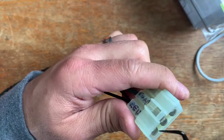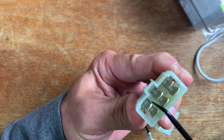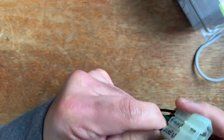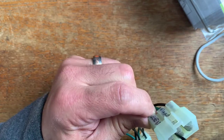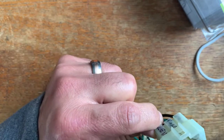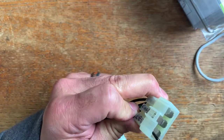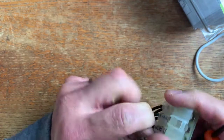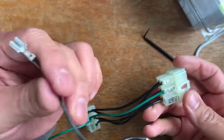On the other side, since it's a flat plug, there's a little plastic piece that sits right above it. You pry that up and you pull back on the wiring. These plastic things can be quite brittle. You see how I'm actually prying that plastic back? That's what's holding the pin down. There it is. And then you can remove and repin to whatever position you need it to on the corresponding plug.